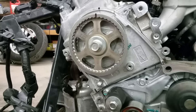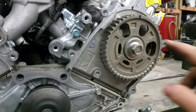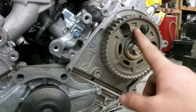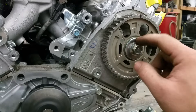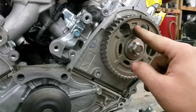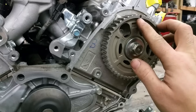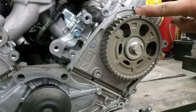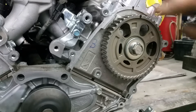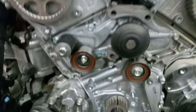On the front cylinder head, very similar — just like the rear. The sprocket is a little different and you can see the numbers: number one, number six, number three, number five, number two, number four. You want to make sure it's at number one. There's also a mark on this tooth here on the sprocket, and on this back cover there's also a notch. I used the Sharpie to mark it so you can see it a little better.